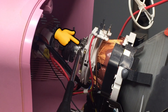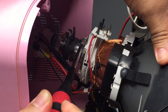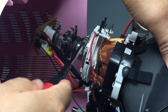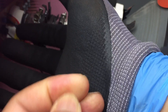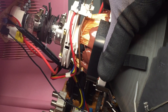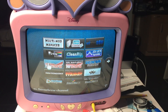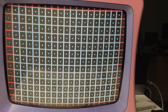To fix a tilted picture, loosen the clamp that is closest to the front of the tube. For maximum safety, do this while the TV is unplugged and turned off. Use gloves and grab the yoke by the plastic housing to adjust for tilting issues. You will need to have the TV on and a pattern input into the TV — here I'm using the grid pattern from the Wii 240P test suite. Carefully twist the yoke until the tilting issues are alleviated.